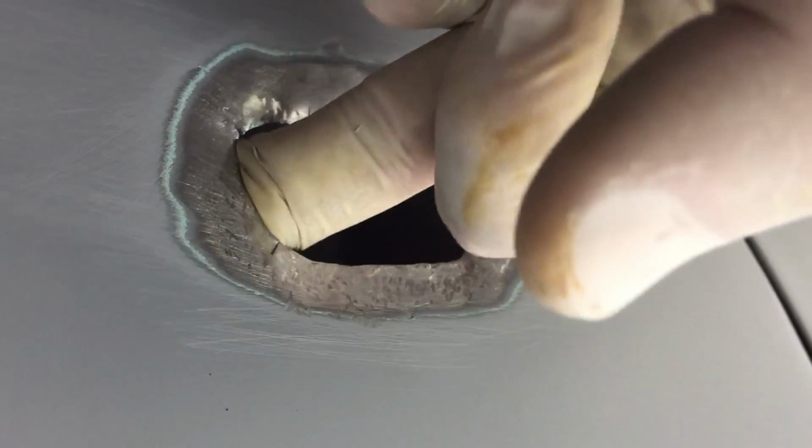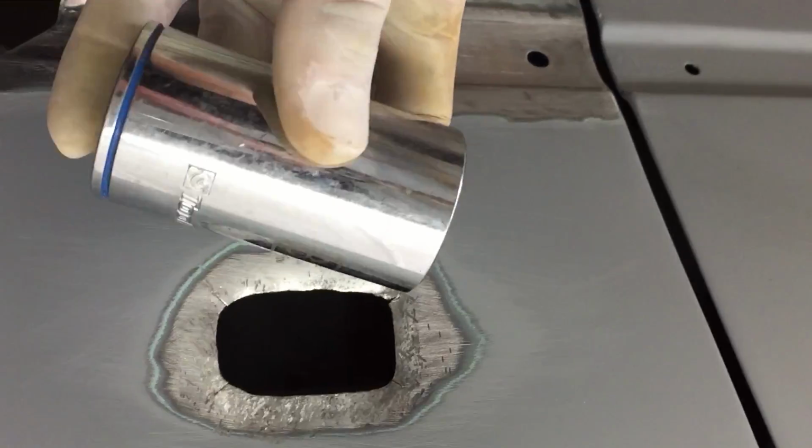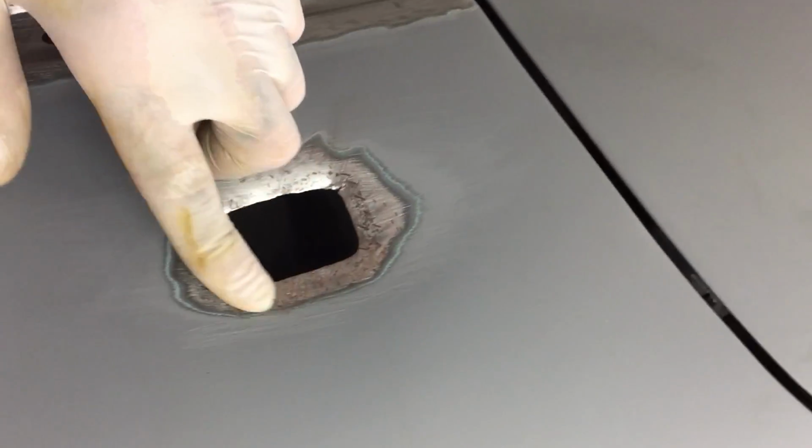Now this is like in its resting state. Relief lines didn't quite work as I thought, so I used a socket like this. You can use a socket or a dolly or whatever. I just put it behind the panel like that and it actually gave you a nice surface, and it would stop you from bending this whole panel down as you bent this edge.